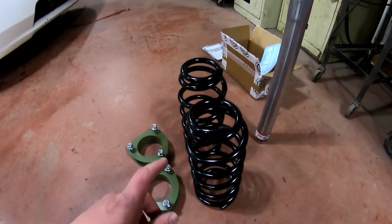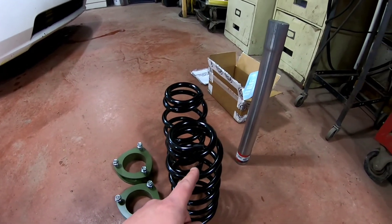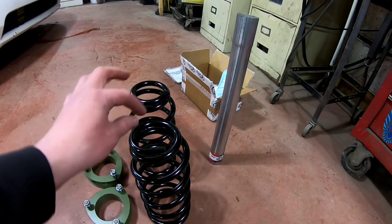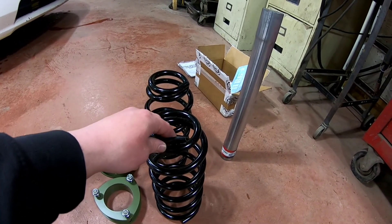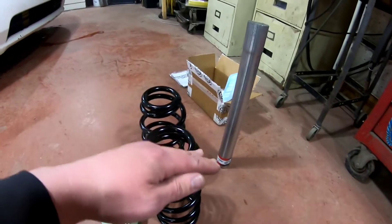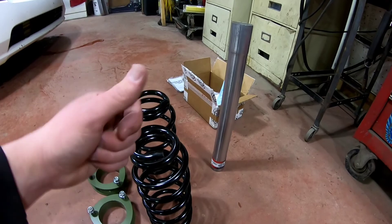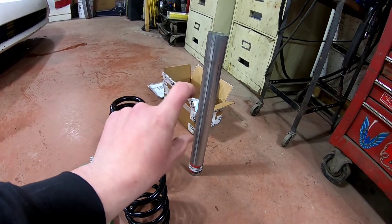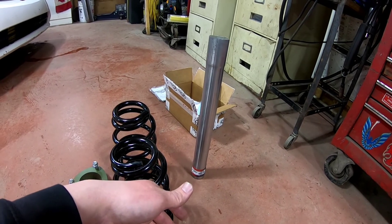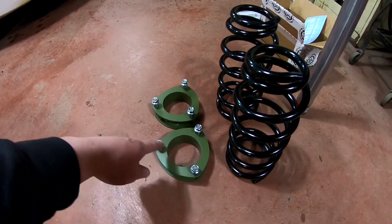I'm going to start off — if you look at one of my other videos, it'll be up in the corner here. The rear springs, I used the sleeves from the lowering kit I had in it, and then the shock wouldn't let the lift work because the shock stretched all the way out. So I got this exhaust pipe to make some spacers for the shocks to allow them to come down to be able to get the lift in the back.